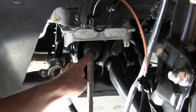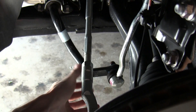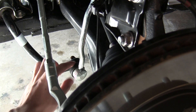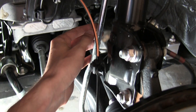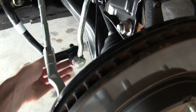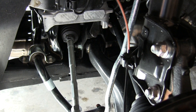Here you have the steering linkage connecting up to the front. You've also got your anti-roll bar right here. It's always interesting looking at how they connect up the anti-roll bars. This one has a very long tube which connects up towards the top of the strut, so when the strut moves up and down it's pulling this anti-roll bar up and down and transferring that force over to the other side.